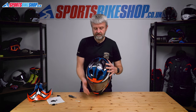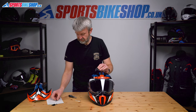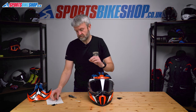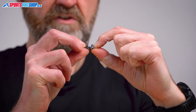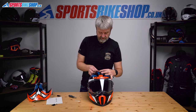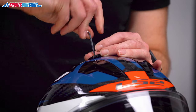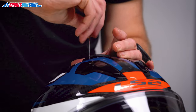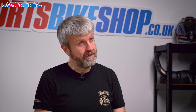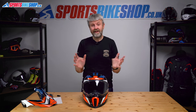That's all good. Now what you're left with is a hole at the top where the peak was mounted, but LS2 have given us something for that — a little plate that sits on top, and there's also a screw for that. They give you extra screws for those plates. You'll see that this one's shorter because you don't want it going all the way down into the helmet — so just a shorter screw there. Put the plate on there, slot that into there, and this one does fasten with the tool that LS2 gives you. So now we've got this helmet in what you call street mode or urban mode without the peak. So that's the LS2 Explorer Carbon in street mode. I hope throughout all of that you can understand what you need to do to change the visor on your helmet. Thanks for watching.